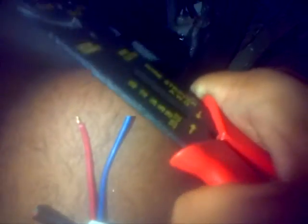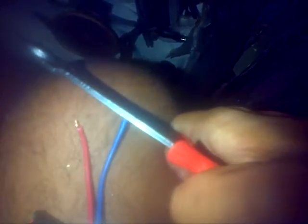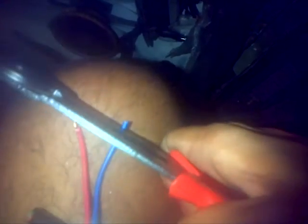How you do that is you have to splice your wires using a splicer. One of these things. You put it inside one of these grooves, you clamp it, and then you hold the wire itself and you pull from the top piece of it. So like right here, you clamp it at the tip however much you want and pull, and then that happens right here.